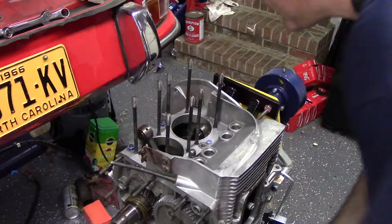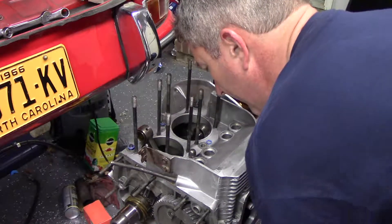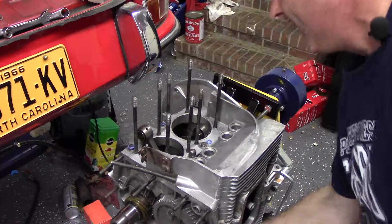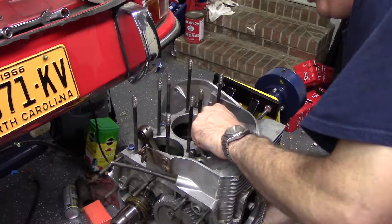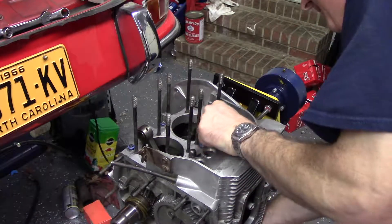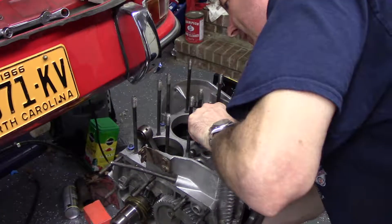This one bolt in the middle of the crankcase is actually a through-bolt — it goes all the way through and has a washer and an o-ring on one side, and on the other side one of the o-rings and one of the beveled washers. That's what seals it.